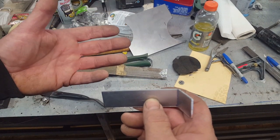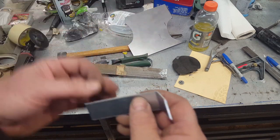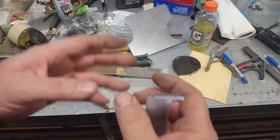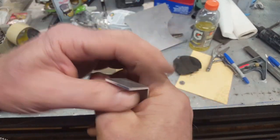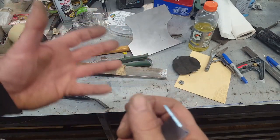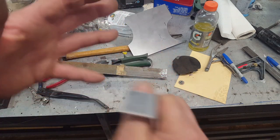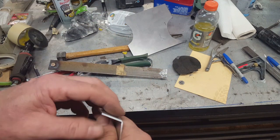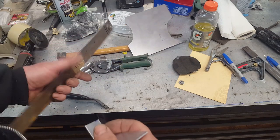I did this with the front fenders when they attach to the nose and the bumper. I put the flanges together first, and then I refined the flanges, and then I brought the fender to the flange, welded it to the flange that was already bolted in place, so that when I separate my two pieces, they're already aligned. There's no trying to put them together, clamp them, and align them, and then drill and put nuts and bolts through.